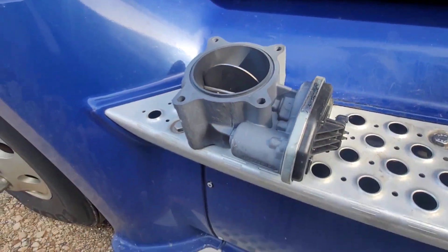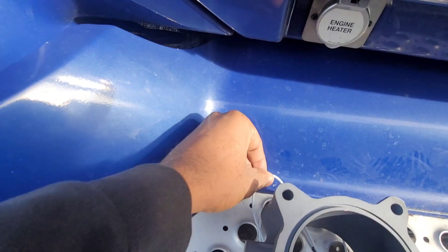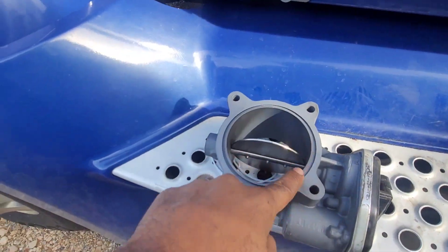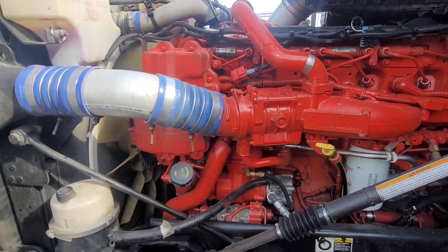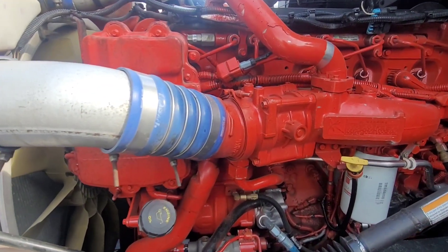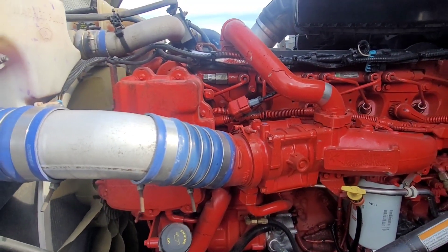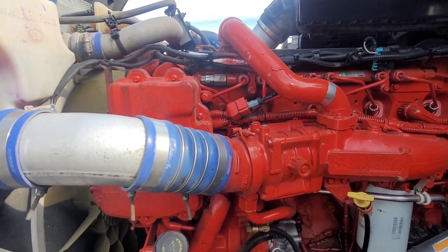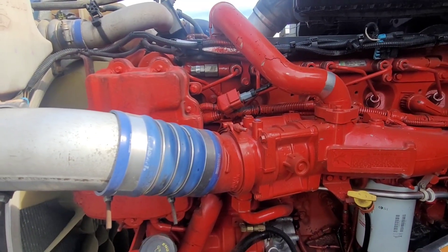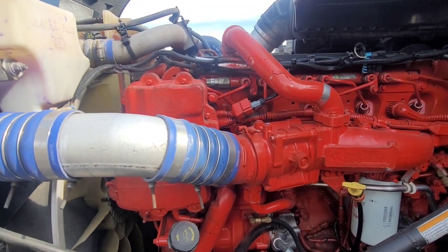I have two gaskets I'm going to replace — they gave them to me for like two dollars a piece. These two gaskets fit around here. I forgot the code I'm supposed to mention in this video, but when your engine throws that code it's usually the throttle actuator with a check engine light. What happens is as it goes bad the check engine light will come on, then after a few cycles go back off, come on again, go back off, and eventually stay on.